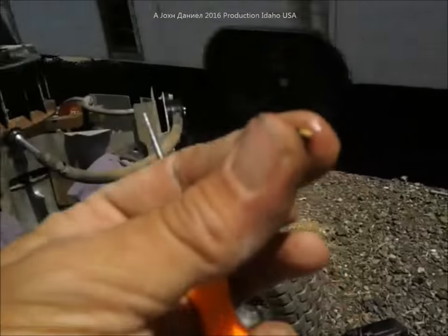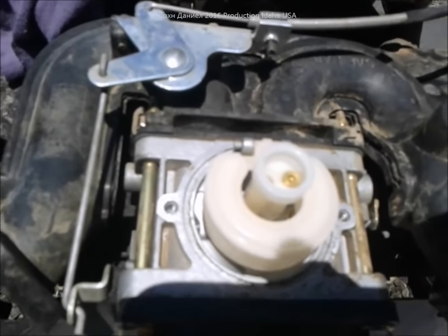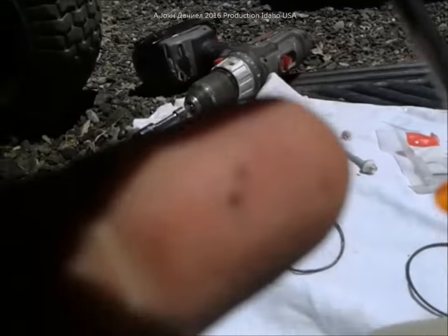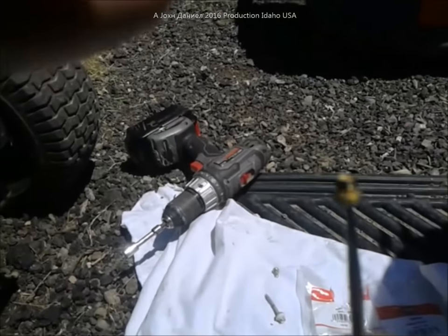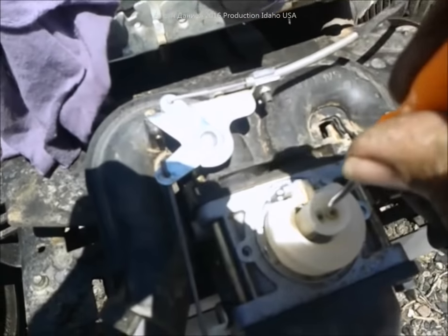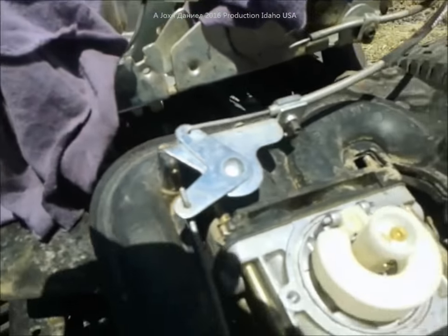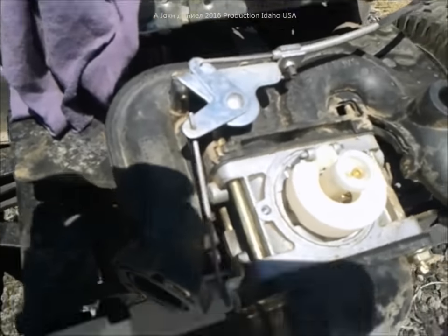I've got the second one completely done. This one here is now installed — there are the two. I'm going to take it and put it on the end of my tool, then very carefully reach up, hold it with the edge of my finger, drop it in place, and give it a little bit of a walk in to where it pops into place. Now they're no longer loose and no longer flopping around allowing fuel to shoot past them, so the governor and everything will work just fine on this engine.